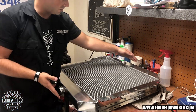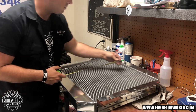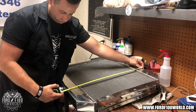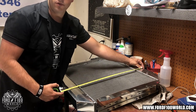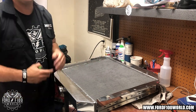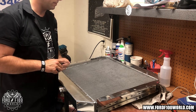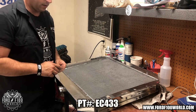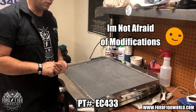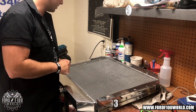For the height, I measured from bottom to top on the stock radiator: 24 and a half inches. The new one is about 25 and a quarter, so it doesn't stick up out of the bottom or top too much higher than the stock. I'll put the Champion part number up on screen. The measurements say it fits — let's see if it's true once we install it, because you often hit roadblocks.